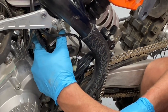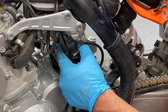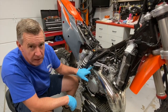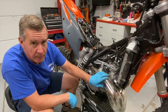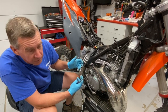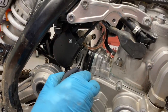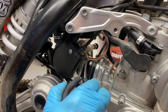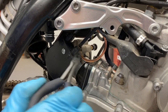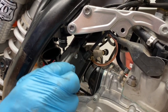Now we're going to remove the oil hose that comes from the oil pump to the throttle body, and then on the other side we'll remove the throttle cables. On that side it's going to be easier to remove the pipe — there's a Torx, and a plastic cover to remove — to get to the throttle cables. You can see the oil hose going to the throttle body; there's a little pinch hose clamp. Remove that carefully, then take out the Torx and carefully remove the cover to get the throttle cables out.